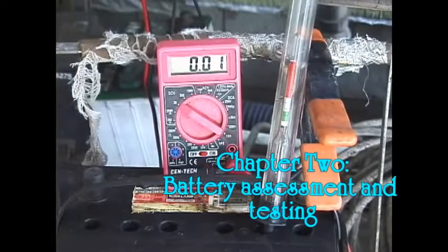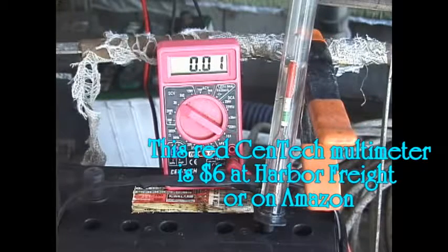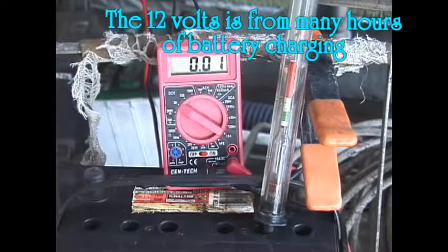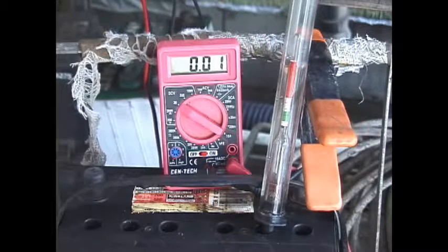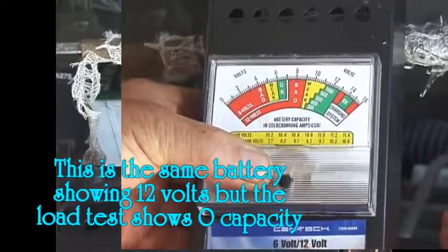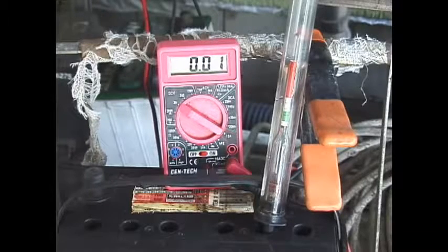Chapter 2: Battery Assessment and Testing. The first thing to do when testing a battery is to have a good voltmeter and hydrometer. Multimeters can be had for around $20 at Home Depot or $6 at Harbor Freight and will be very helpful when diagnosing electrical problems. Hydrometers are less than $10 — the one shown here costs $6 at the auto parts place. A battery can have the full 12.8 volts but have a low hydrometer reading indicating no actual capacity. For restoration projects, it helps to monitor progress with a hydrometer and multimeter. First check the voltage, then check each cell with the hydrometer, and clean the top of the battery and the battery posts so you get a good connection with the charger.